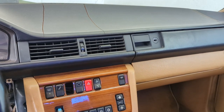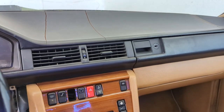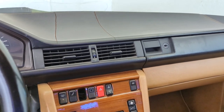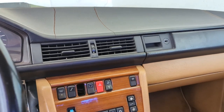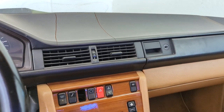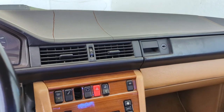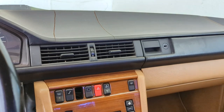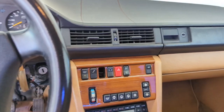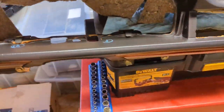Something under here too: there's going to be a lot of vacuum lines, and I've gotten new rubber connectors for all the parts where the vacuum lines connect. I'm pretty sure there are going to be some really worn-out, crispy, broken ones. I'll be able to refresh all the vacuum lines and vacuum pods under there before I get started.